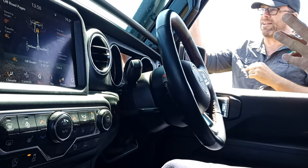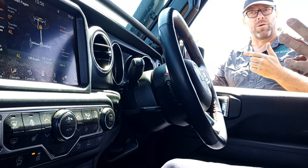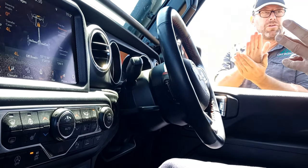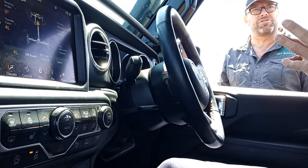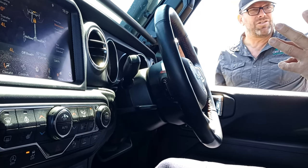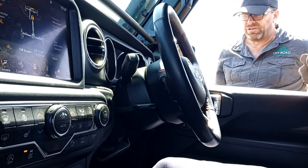I've had it on this lane further on where it used to be really wet and slippery, where somebody's coming up with a Land Rover, spinning the wheels, having loads of fun, and then all of a sudden they got grip, bang, half shaft snapped, and then I had to drive back to Worcestershire with the centre diff lock on, because they hadn't got any drive. They're just little things to avoid.